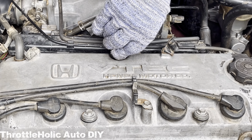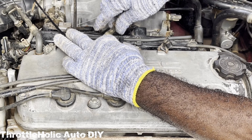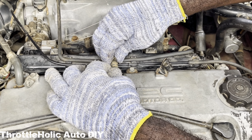Make sure that the valve faces the hose where it must connect. Using both hands, with one holding the PCV valve firmly and the other one guiding its connecting hose to it, connect the hose back to the PCV valve via the designated port. This is usually easy, but we need firm, steady application to get it nicely in and in position.